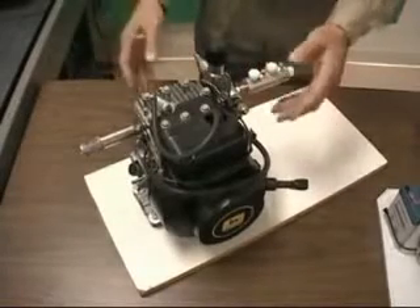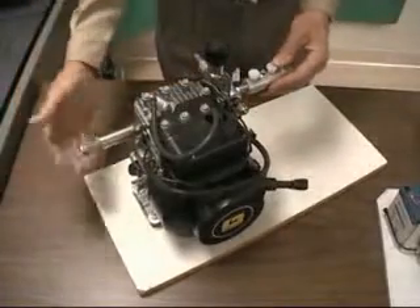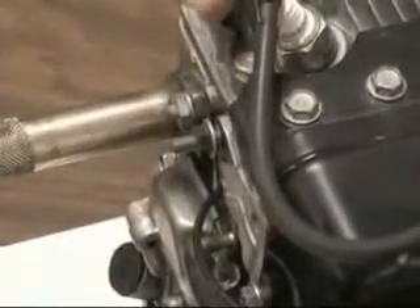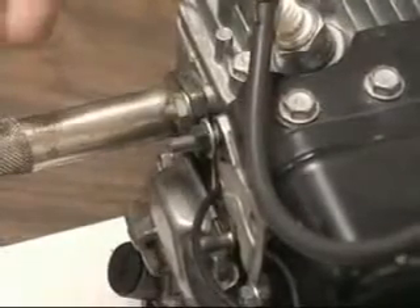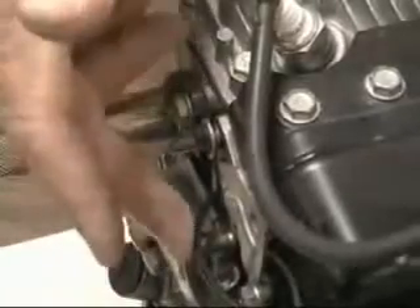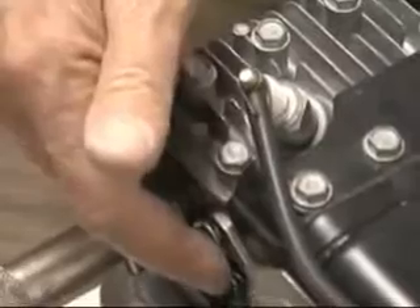We're showing how to make a very inexpensive conversion by removing the carburetor and letting the engine breathe without restriction — all the air it can get on intake — so it'll have more air in the compression stroke and more air available for burning more fuel. This is the five horsepower John Deere we were looking at earlier, shown now in the least expensive conversion mode, just using a delivery tube to bring the hydrogen right to the intake valve port.